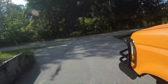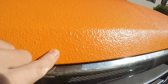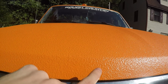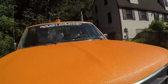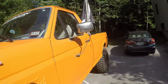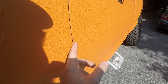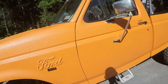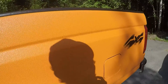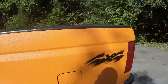You can see this area right here is just kind of running, but then right here you can see that nice bed liner texture. You really want to go with light coats — this is kind of a screw-up right here, but it's the only spot on the truck where that happened. When it comes to cracking, I haven't noticed any cracking other than a little bit around the seams, because the thick material makes the seams a little closer together. I just touched it up with some paint and you really don't even notice it.